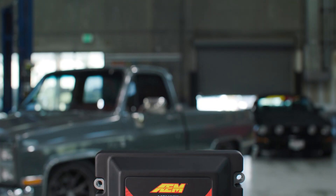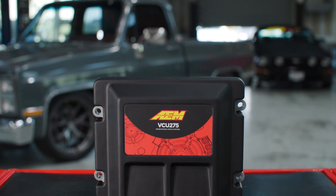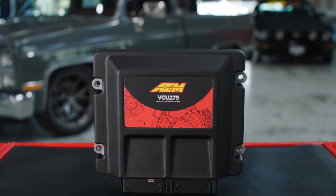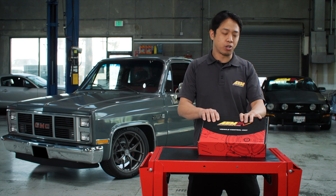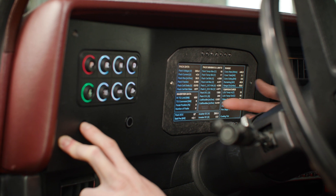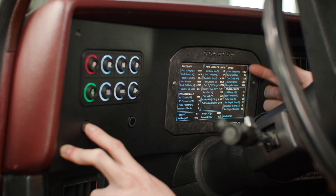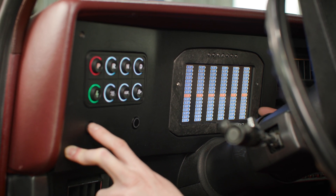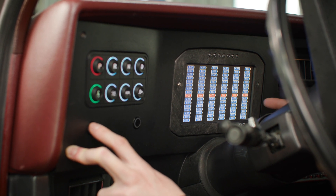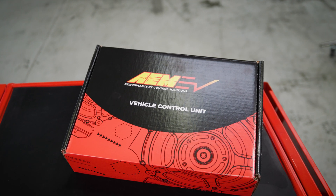Some of you guys might be asking, what's a VCU? Well, unlike traditional engine control and EFI where we have an engine and we need a control unit — i.e., an engine control unit, ECU — we're not necessarily controlling an engine with a VCU. Instead, we're controlling the entire vehicle: everything from torque management of the drive systems, the cooling pumps, fans and radiators, valves within the cooling system, the entire battery as well, keeping that balance, charging systems — literally everything. So this is why this is called a VCU and not an ECU.